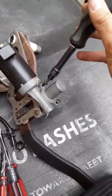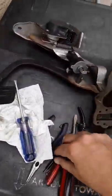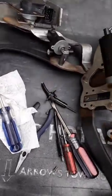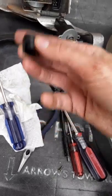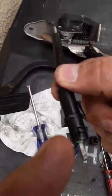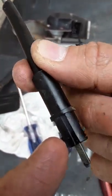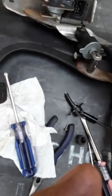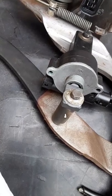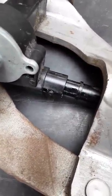If you want to pull the pedals out, take that piece off. On this one, it has little pop tabs. Once you take this little locking device off — which is this guy right here — once you unlock this device, spin it, unlock it. This is sitting in there and there's these little pop pieces. Take a little screwdriver. You see right here — there's a tab there, a tab there. That sits in there in the pedal. You can see the tab hole right there. It sits in there. You just pop that out.